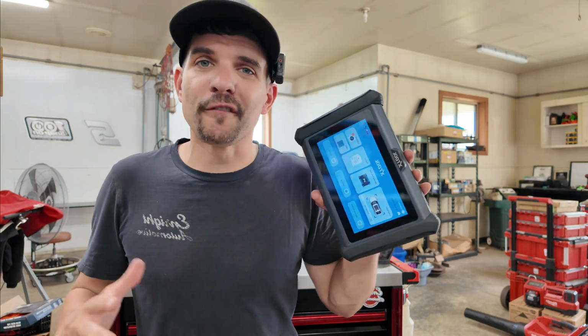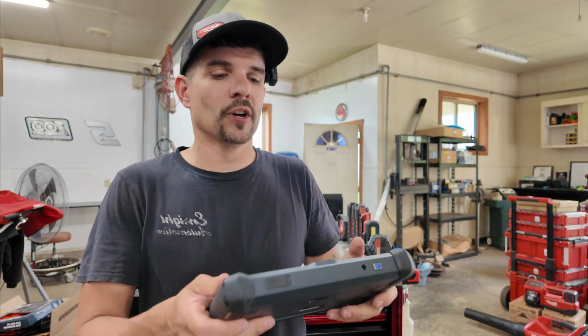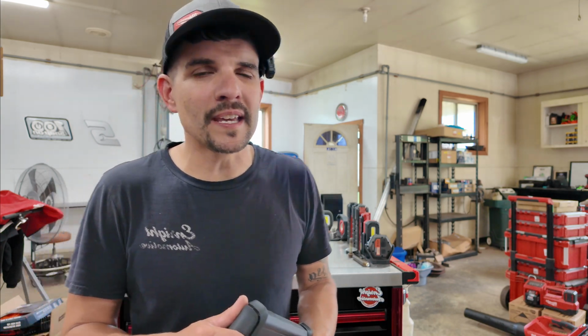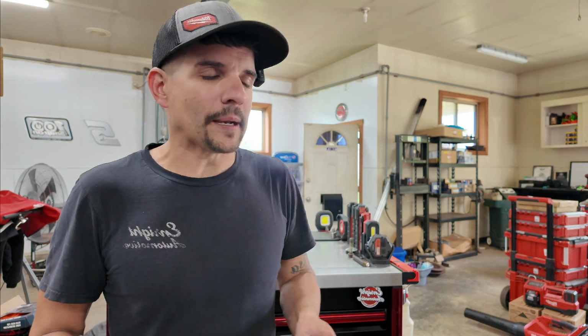So I'm going to just go over the features in the first part of the video. The features are, it does do CAN FD. It does do key programming on some vehicles. Remember, anytime you hear key programming, most likely it's not going to be every single vehicle out there. There are very choice few scan tools that actually do that. A couple of them being the Autel IM508, the IM608, and nowadays you're going to need a VSP credentials to be able to do that.